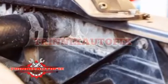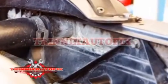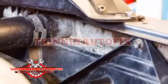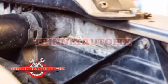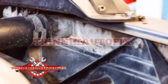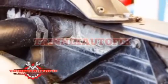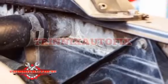Push the new hose in place. Ensure it fits snugly and sits firmly at each attachment point. Slide the new clamps in place and tighten them to manufacturer specs. Close the petcock on the radiator. Fill the radiator with coolant. Make sure you use the right mixture and type. You also want to research how much your vehicle uses before you get started so you get it full.